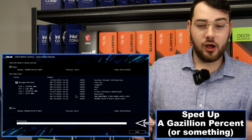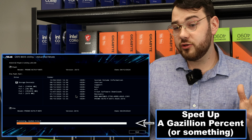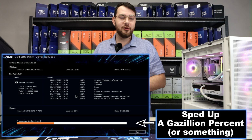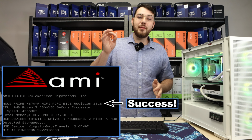On a quick little side note, while your system's updating the BIOS, you want to make sure you don't turn off the system, no matter what you do, otherwise you could possibly brick the motherboard. So if you're one of those impatient people like I am, just go outside, go grab a coffee, go grab a water, and in about 5 minutes the BIOS will be fully finished and installed. And just like that, in a few simple steps, we managed to install and update the BIOS on the Prime X670-P Wi-Fi motherboard.